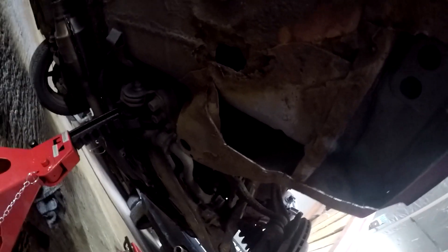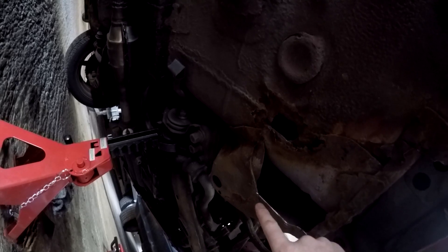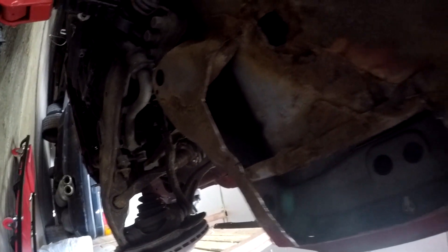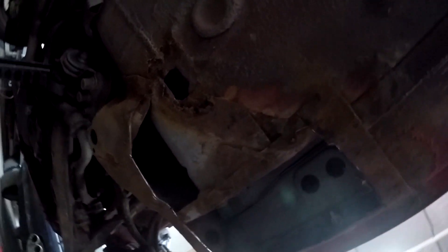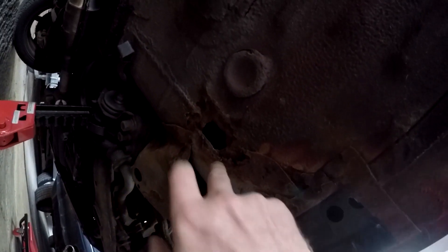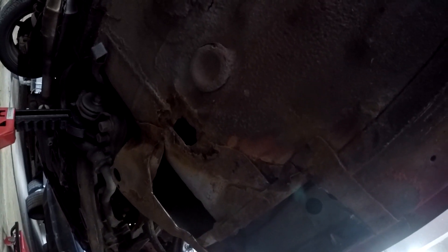There are two or three bad spots. This corner was really bad so I took one plate out. I can sand this down, make it all clean, then I have some epoxy rust converter that's going to be sprayed on and left to dry. This hole still needs to come out and I'll make a little patch plate, then connect it back up in this line. It's not as terrible as I thought - this is doable. The material is still strong and good, so I can scuff it up with a flappy disc on the angle grinder, make it all nice and clean, and cut this one out and put new stuff in.